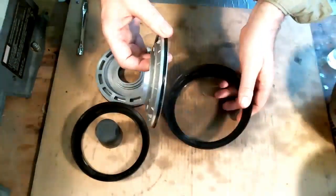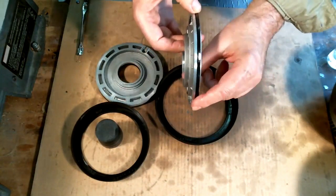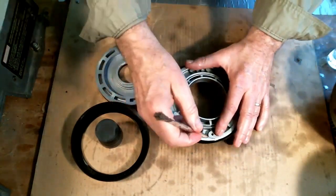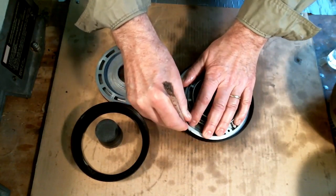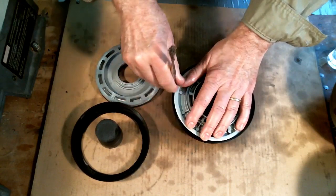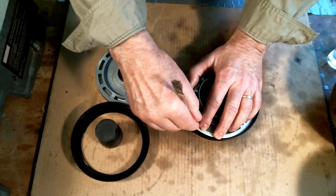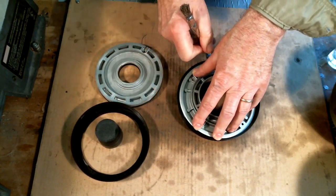We want to install the piston lip side down into the tool. Now because it's funnel-shaped and the lip has a sharp edge on it, it normally is not going to just drop right into place — we're going to have to kind of help it along. That's why I have this little wire tool. We'll start in a corner and kind of move it around. Just be real patient with it. Once you get it all the way around it should go in there. It's real easy to flip those seals backwards, so be very careful of that.